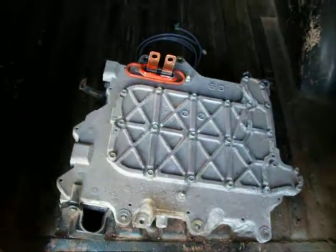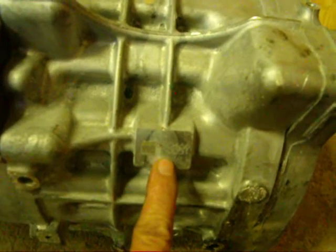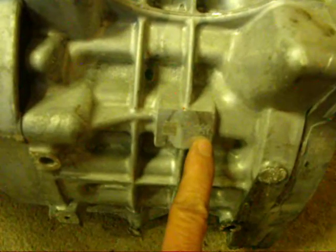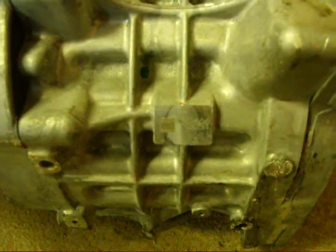Here's the other controller from Montreal — I'll open the back door so you can see it. I don't have a motor that matches this one. What I've been told is that to replace a motor or a controller in a Nissan Leaf, you have to type in a code — you have to program the inverter with the right code. Right here on the motor there's a number, and that number corresponds to how the resolver is positioned or how it's built.